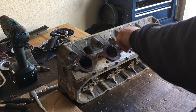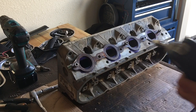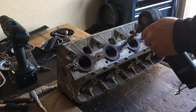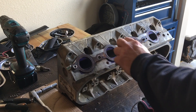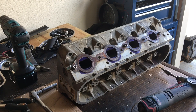Basically, what I want to try to do here is position this thing, snug it down, and then scribe where I'm going to do my porting work. You just want to get this thing where it won't slide around when you take your sharpened implement to just put a small scratch. Just push hard enough to take the Dykem or the Sharpie off, because it's really kind of annoying when you put real deep scratches in there as a reference point but then don't port to that scratch.